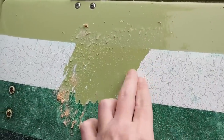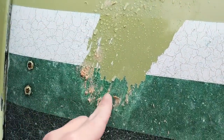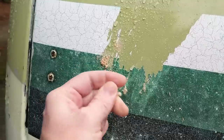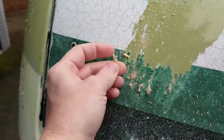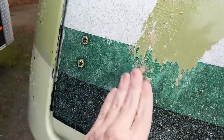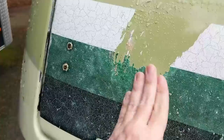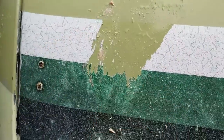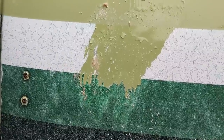the surface stays cool enough with the water for a minute, but eventually the wheel just starts melting, and instead of removing vinyl, it just leaves a thick, gummy residue of melted wheel stuck to the motorhome. So buyer beware on eBay buying these eraser wheels. You better give them a try as soon as you get them in the mail, and make sure you contact those sellers if you get the faulty wheels like I've gotten.